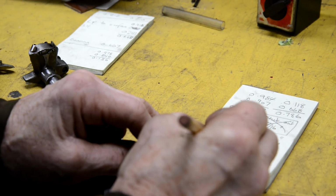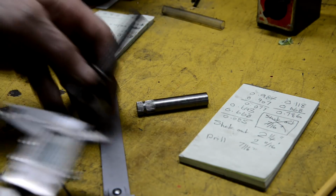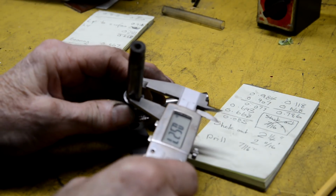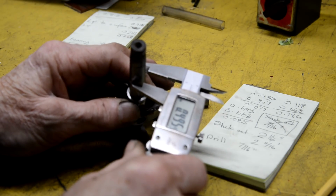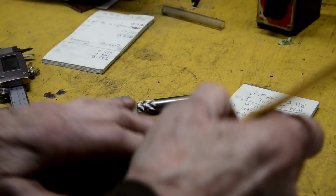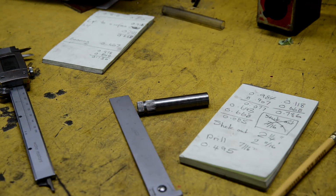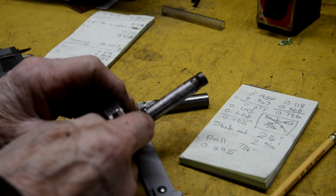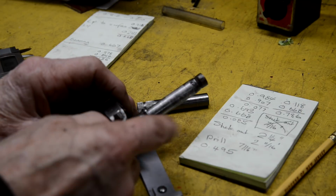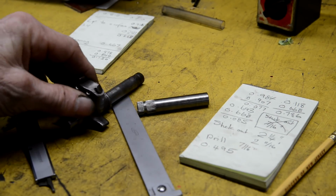So we're going to stick it in. We're going to drill 7/16. And for the drill, well, that's 495½ thou. So we want to drill, see if I can find one just under the 1/2 inch. If need be, what I'll do is turn 7/16 of this just slightly smaller to match a smaller drill and then put it in, and that way it'll press in nice and tight and I can just put some weld round.